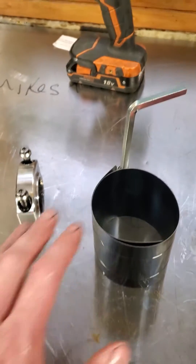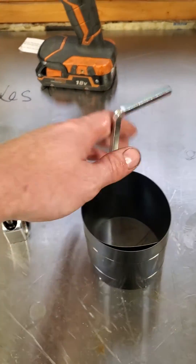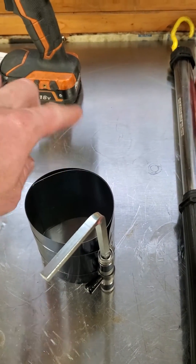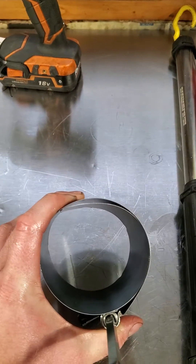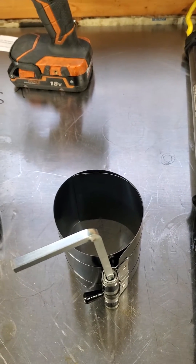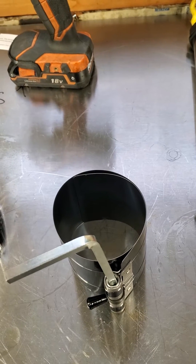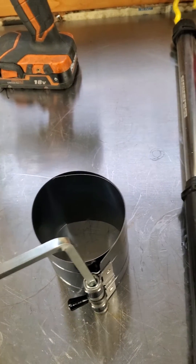Right here is what you have — your typical cheap do-it-all ring compressor. You have this little tool that tightens it up and you put it around the piston. It forms around the piston, but obviously it's not perfectly round — they never are. You tighten this down, and once you have it tightened down the piston is in there pretty firmly. You usually have to use a dead blow hammer to knock the piston into the cylinder.